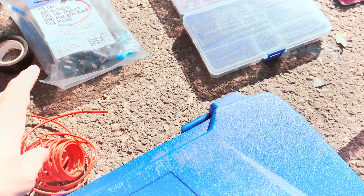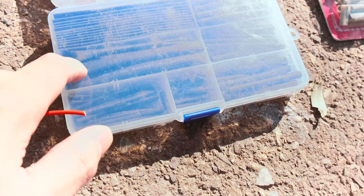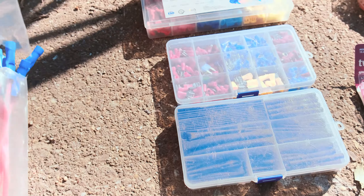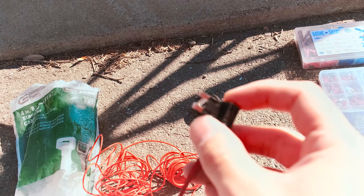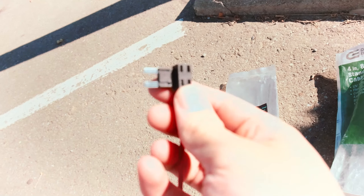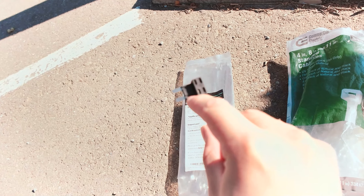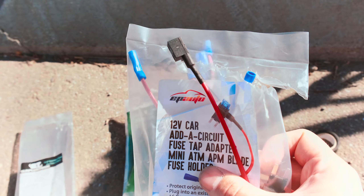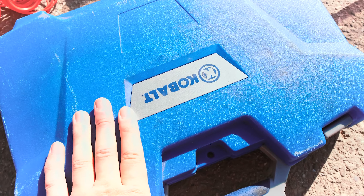Some tools you're definitely going to want for this job in our car specifically: zip ties to tidy up the excess cabling — there will definitely be some in our small car; some wire, this is 16-gauge that I got at Walmart; heat shrink tubing for my negative lead so I know it's my negative. The thing that will make this super cool for our car is a 12-volt add-a-circuit fuse tap. It lets you fuse the old line exactly to spec and lets you fuse up the new line, where we can add our 5-amp. I'll explain later what we tap into, which is actually a 20-amp switched circuit. I'll link everything in the description.